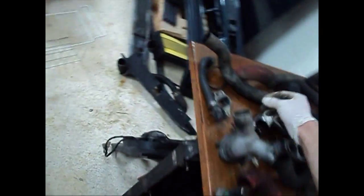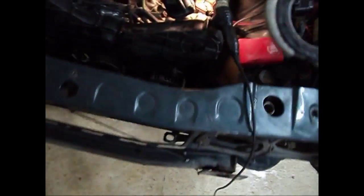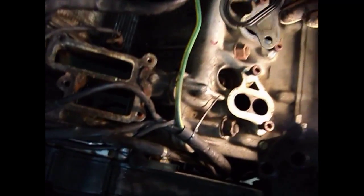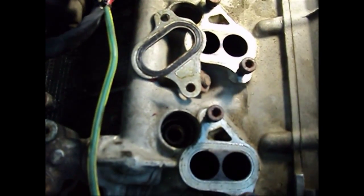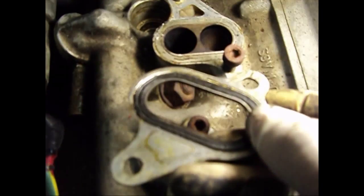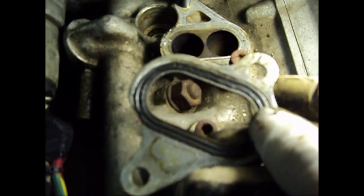The radiator is still in good condition, so it will just be cleaned up, checked out, and refitted. These are the gaskets to the intake — I believe someone took them out and put the same old ones back in. As you can see, they are not placed properly, so they've got creases all over, and some of them have even chipped off a bit.